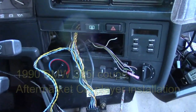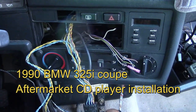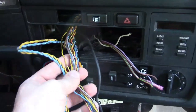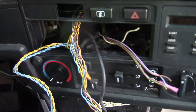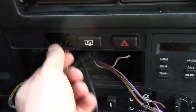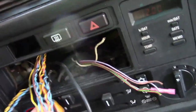I'm getting ready to install an aftermarket stereo head unit in my 1990 E30. Mine has just the basic system without an amplifier. What you'll get from the factory is everything wrapped in BMW cloth tape, and it will be confusing because there's a potentiometer resistor right here that splits the two speakers left and right.